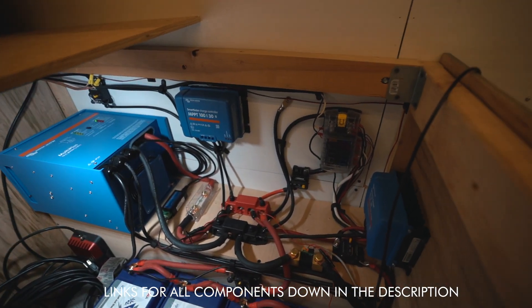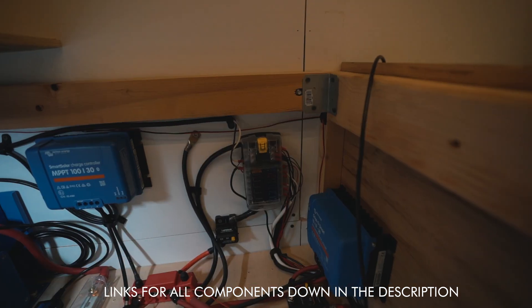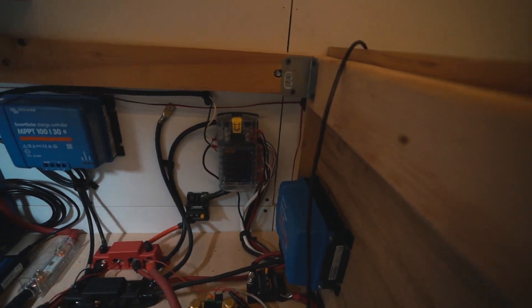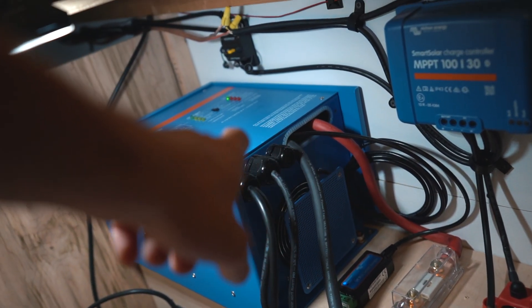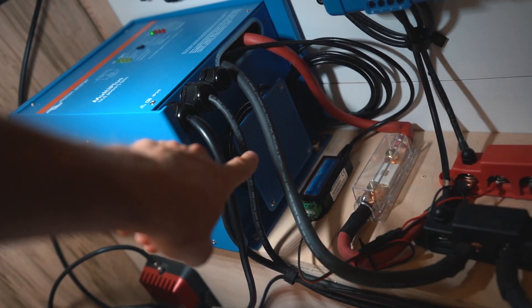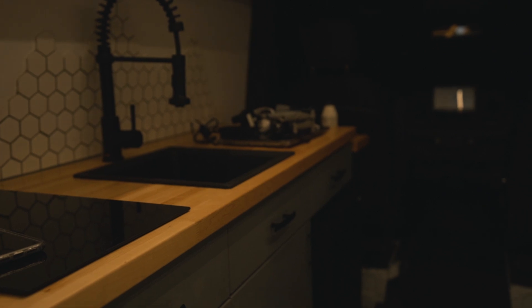Moving on, we have our outputs — two main ones. Right over here is our 12 volt stuff: the fridge is 12 volt, the lights are 12 volt, and the WeBoost down there that's boosting our cell signal is also 12 volt. Pretty low energy stuff. But for these 120 volt outlets, you have to amplify the energy, and that's where the MultiPlus comes in. This cord right here is running from our 12 volt power through a fuse all the way to the MultiPlus, which charges that energy super intensely and then sends it back out to our outlets. We have an outlet here, an outlet here, one up front, and that's where the drones, laptops, water heater, and induction stove all work off of.